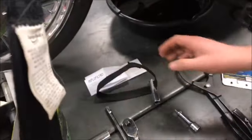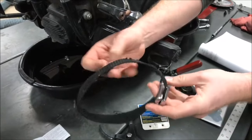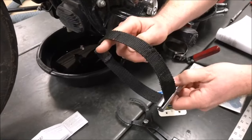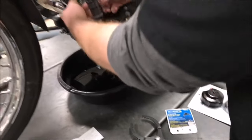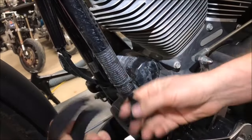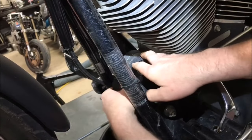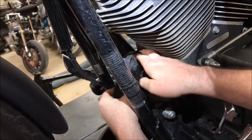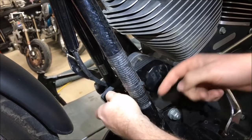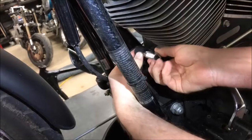Here is my favorite — we all have the one we like. Multiple vendors sell this through Parts Unlimited and Tucker Rocky, but this oil filter strap wrench is only about eight bucks and it'll handle a ton of sizes. What you do is slip it around the filter — I'm going to sneak it around, move the seam to a new spot if it gives me grief — and then I want to go as far in toward the base as I possibly can. Then you wind the strap up and set it more toward the top.